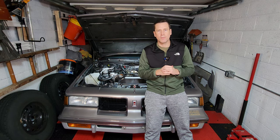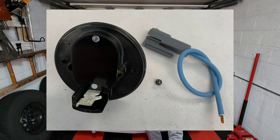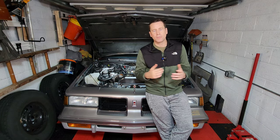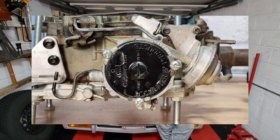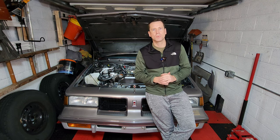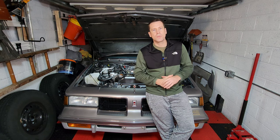There are two types of choke systems: electric chokes and hot air chokes. The electric choke has a wire that runs to the choke valve on the side of the carburetor and operates almost like a toaster — electric current heats a coil, which opens the valve on top of the carburetor and slowly feeds more air in until you reach operating temperature. A hot air choke does the same thing but draws hot air from the intake manifold to open the spring inside. For our purposes, it doesn't matter which you have — they both function the same.